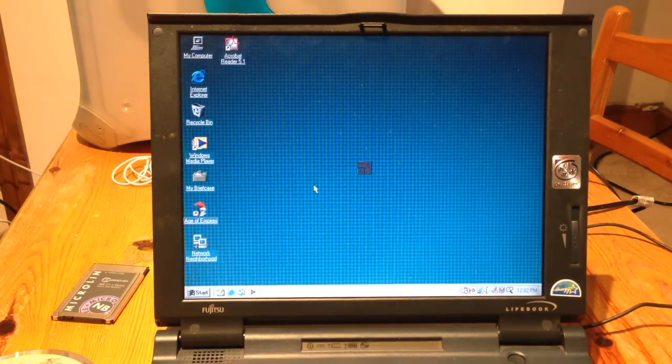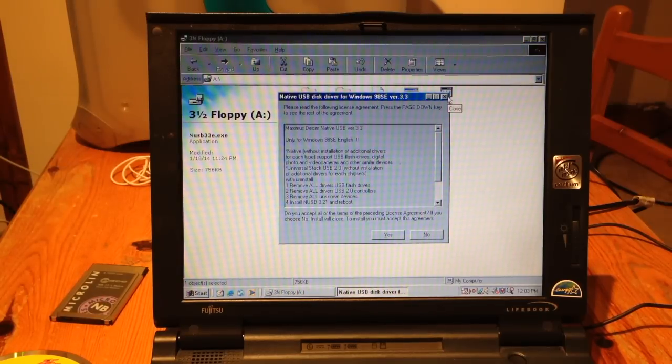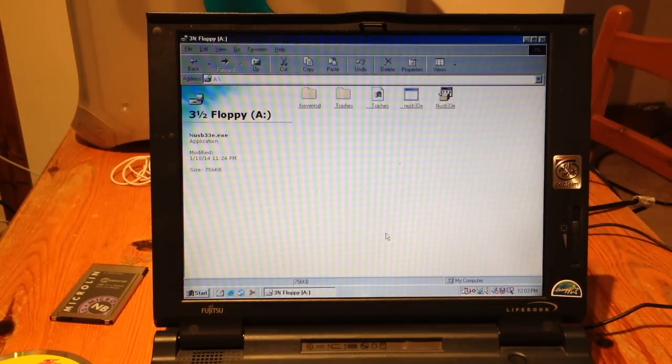What am I going to do with it? On this floppy disk there is the Universal USB Driver from Phil's Computer Lab. On this USB key is Firefox 2.0, and I'm going to get this online and see if I can browse the internet on it as if it's 1999. Big shout out to Phil's Computer Lab for providing this on his website. I think the driver was originally lifted from Windows ME drivers, since Windows ME came with native USB support. After I reboot, I should be able to plug in a flash drive and get USB support working.